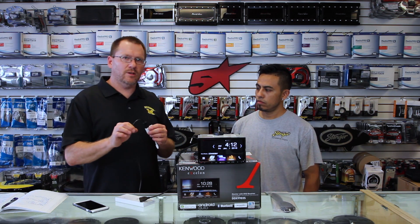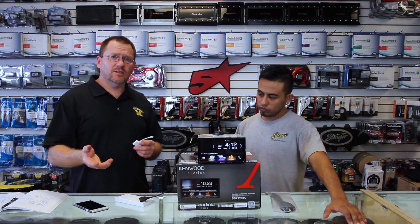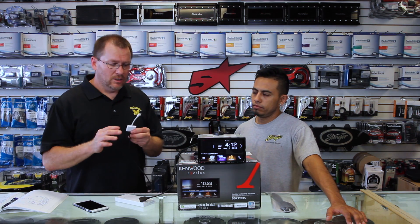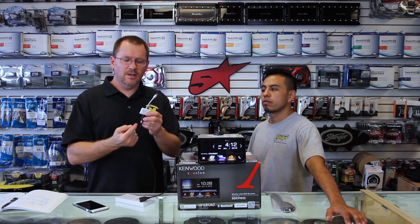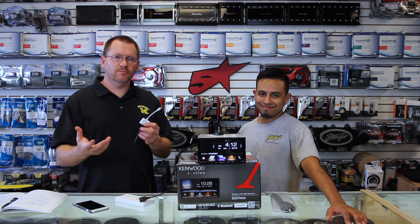The USB power connection is not mandatory — meaning it's not needed in order to watch video; it's only there for charging. A lot of you guys also like to ask, can I do CarPlay through this? Meaning, can I just plug this in and do CarPlay? The answer is no. How this cable is designed to work is that it's just an authentication chip on one end and a receiver on the other — all the lightning port does is charge. No data comes over it, so unfortunately, right now, no CarPlay.